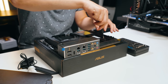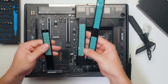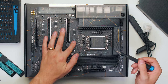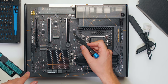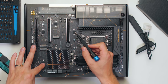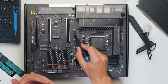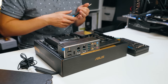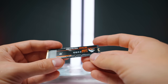Let's remove the heat sinks and show you what M.2 options we have. As you can see, all the heat sinks have thermal pads on them to keep your SSDs cool. Unfortunately it's just one-sided, not double-sided as on some motherboards, but I think it's all right. One cool thing about the M.2 storage is the tool-less ASUS latch — you don't need to actually screw any screws. Those little rubber squares from the box go on top of these rubber square standoffs. If your M.2 drive has chips only on one side on the top, you want to install the little rubber square so that the heat sink on top makes proper contact and you get better thermals for your M.2 drives. If you have chips on both sides of the M.2 on the bottom as well, do not install that square, as it might damage your SSD.